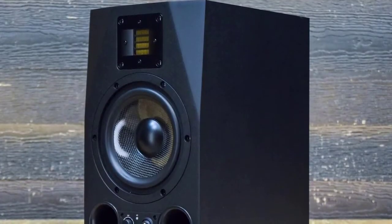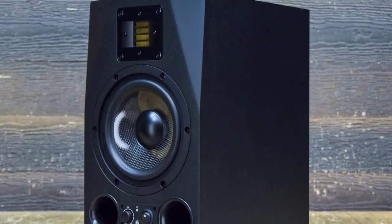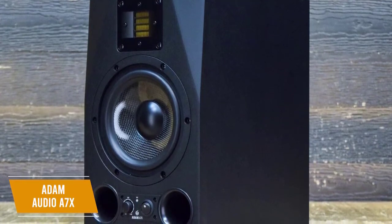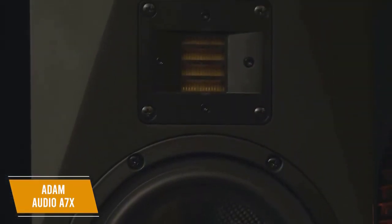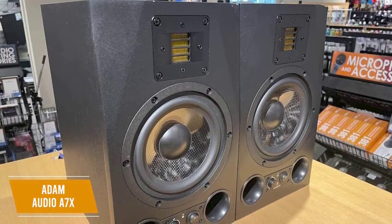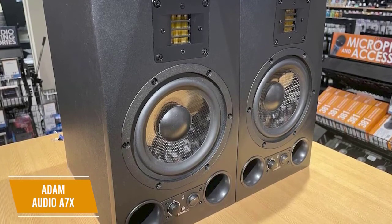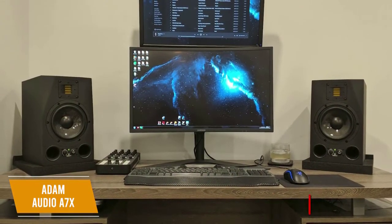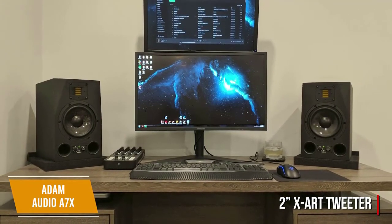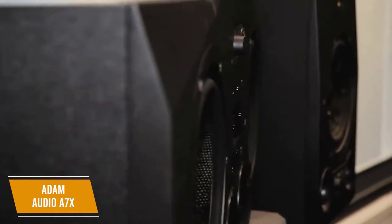If you're looking for a studio monitor that delivers the best overall performance, the Adam Audio A7X is a top choice. The $1,500-per-pair Adam Audio A7X Studio Monitor is a revamped version of their respected A7 model, with improved sound quality and new features. You get an innovative new tweeter for an extended frequency response, a clean and versatile soundscape, and several easily accessible controls. The A7X comes with redesigned drivers, and its folded ribbon tweeter design delivers up to 2.5 times the volume of standard drivers with more consistent impedance. It has a 7-inch bass and mid-woofer along with a new 2-inch XART tweeter that reduces distortion and extends the response range from 42 Hz to 50 kHz. The tweeter is powered by a 50-watt AB amplifier and the woofer uses a 100-watt PWM amp, which maintains phase linearity and provides more powerful audio output.